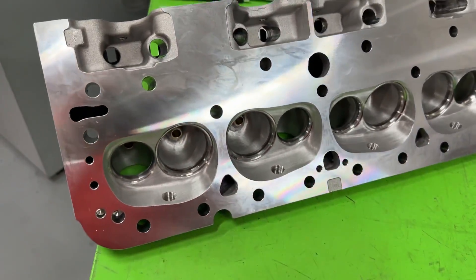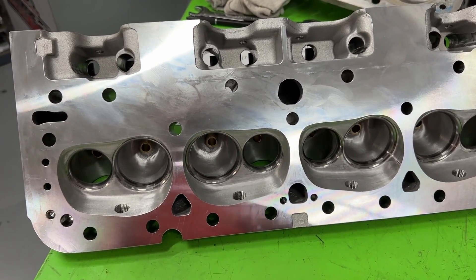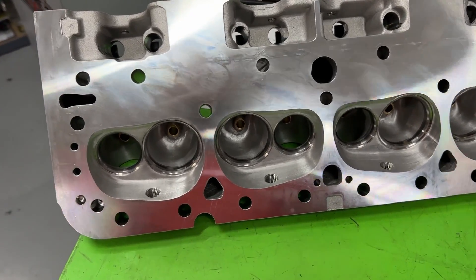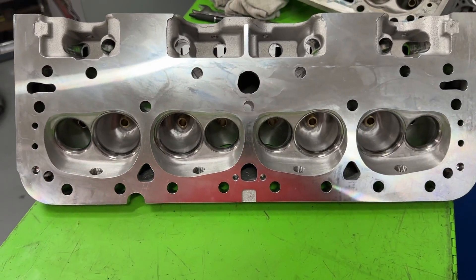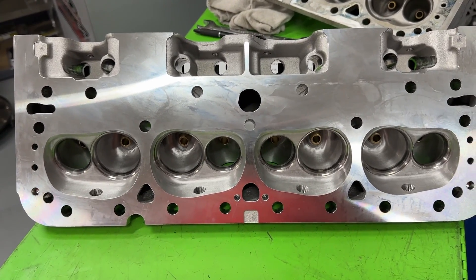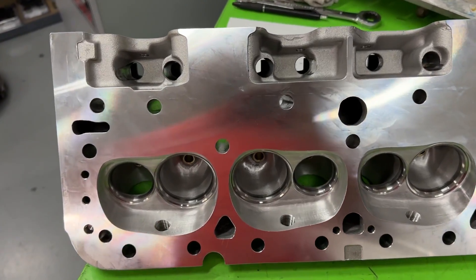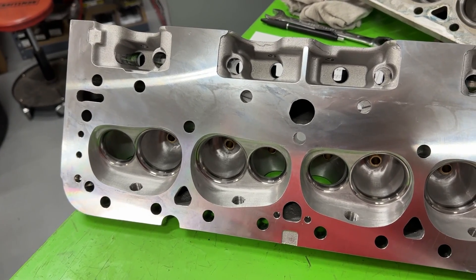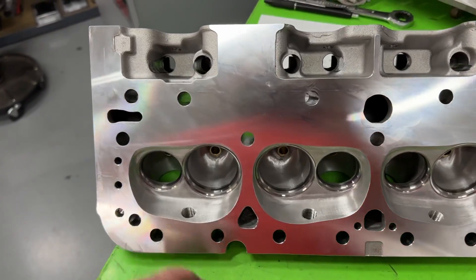This is what got me. These chambers are very outdated — this is a horrible chamber design. Some of you who've been hot-rodding long enough will know that chamber looks a lot like the Edelbrock Performer RPM heads on the small block Chevys, and you'd be correct. Many, many years ago when Edelbrock had their Performer RPMs, their chambers looked a lot like this. It almost looks like they took a double hump head and made an aluminum version of it.